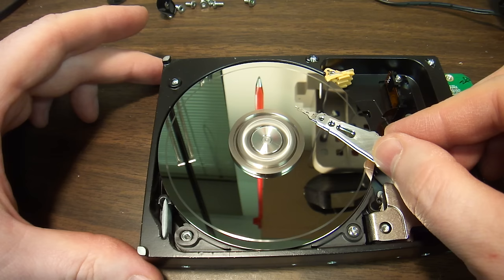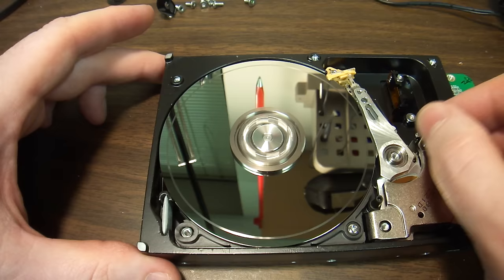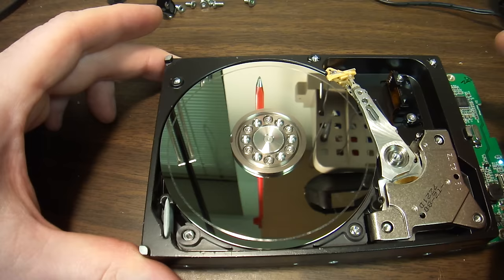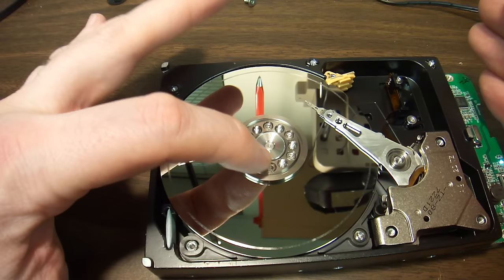What I'm trying to do is force it to read something on the hard drive and hopefully have it register on the computer. The hard drive is not happy. It says there is something definitely horribly wrong here — it'll just turn itself off and park the heads. In this hard drive, heads left on a platter are not a big deal; it's a desktop hard drive with a lot of power to start.